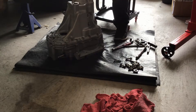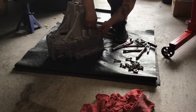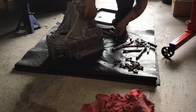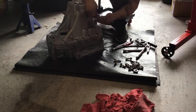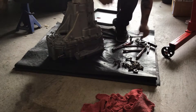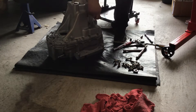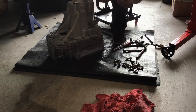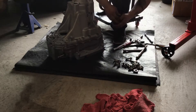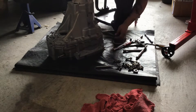These two detents, springs, and retainer bolts — take this first one out. There is a spring in there. Second one, and behind those there are two little balls that actually hold the forks in place. What I like to do is get a magnet and stick it in there, pull the ball back with it — comes off nice and easy. Then I just keep those together with the magnet.